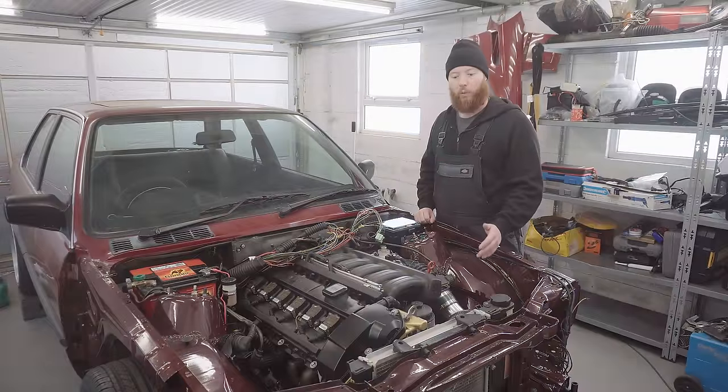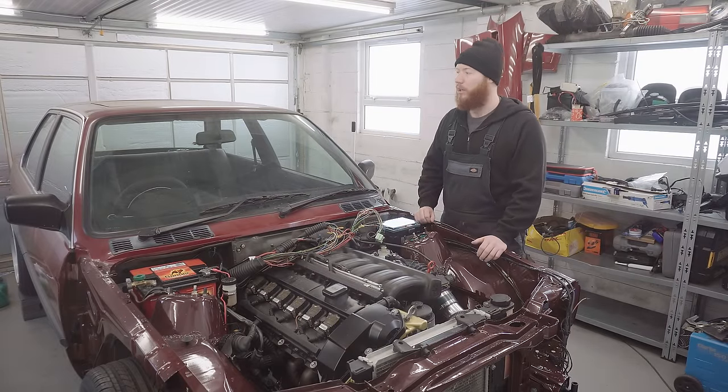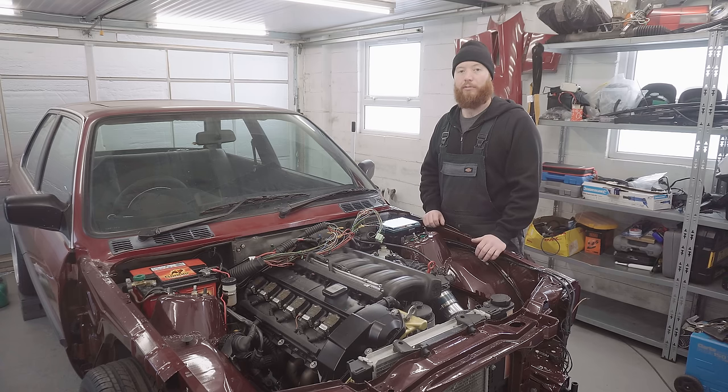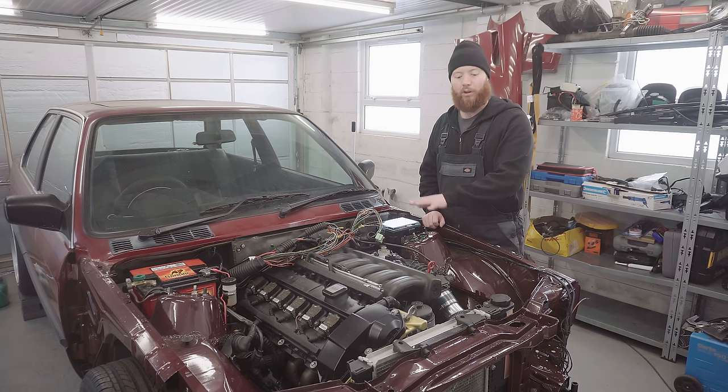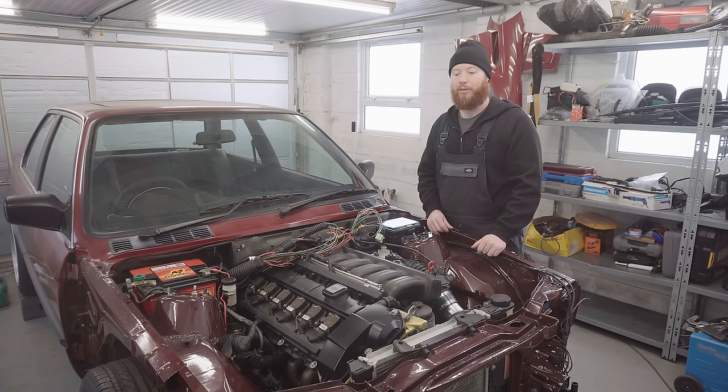Right, so we've spent a little while trying to get more than the 4 litres that we got out into that yellow box. We have raised the back end of the car and lowered the front end, but the remaining 4-ish litres that's still in the system is not for budging. I suspect it's all sat in the block and won't pour out. I am aware that there is a drain plug on the side of the block which is actually tucked behind the manifolds. I'm hoping to avoid getting into battle with that really.